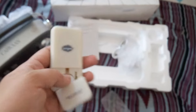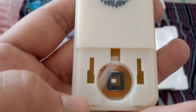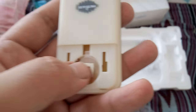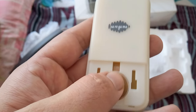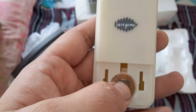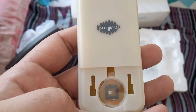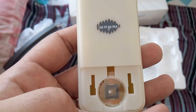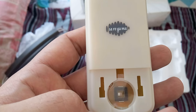Let's open the back cover and see what's inside. A cell is also included — CR2025 is the number — and there is plastic protection so that you have a fresh cell when you start using it. You just need to remove the plastic, put the lithium cell in, and it should start working right away. When I started using the remote control, I noticed the metal contacts on both sides — the plus and minus — were slightly loose, so I had to tighten them. It does not require too much effort, but it should be done if your remote control does not respond well.